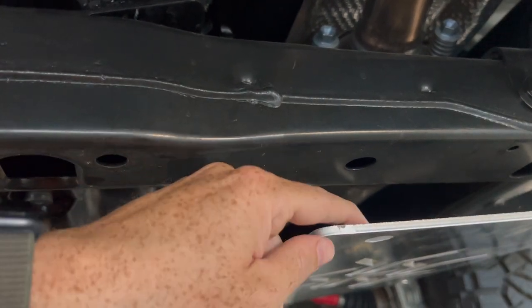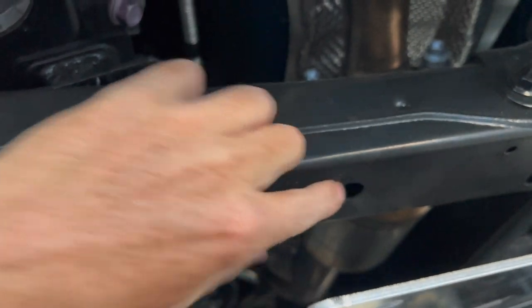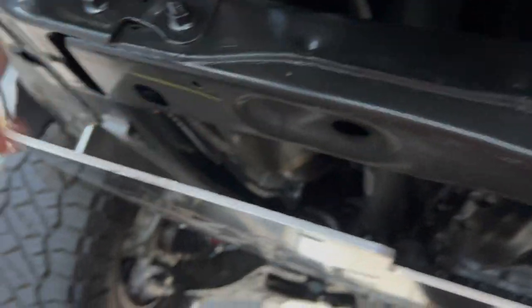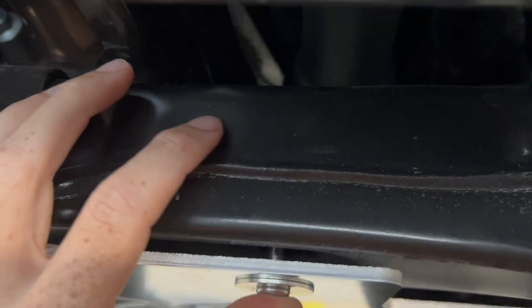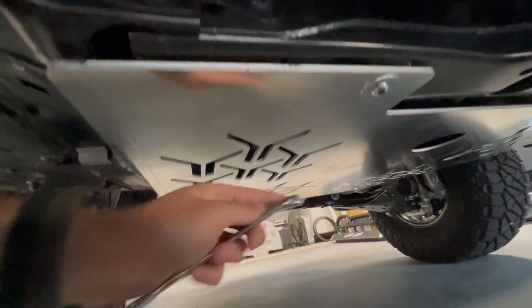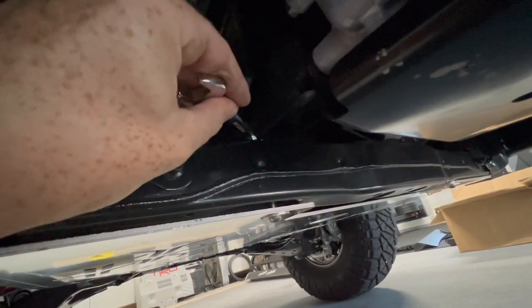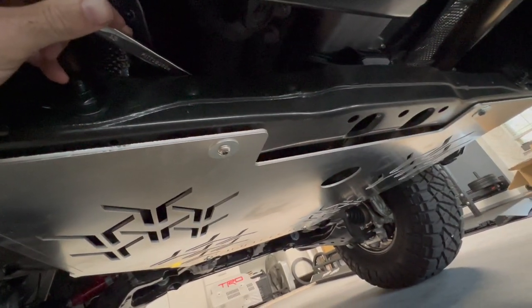So now coming to the back, you can see these holes right here in the plate. If you press it up, there is a hole right here in the cross member, and then another one right here that it goes through. But this isn't threaded, so that is why you're going to take a screw and a washer, send it up through. And then you are going to take another washer and a self-locking nut and put that up top up here. And to secure the back one, it's a 13 millimeter wrench — just go ahead and secure it to the top of that nut. And then using the provided star Allen key, go ahead and tighten up the back bolts.